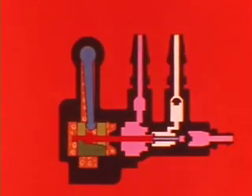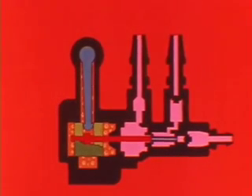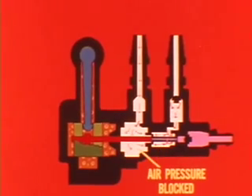This delays opening of the air passages up to one minute before the sensing valve either admits air pressure to the shocks or releases it. Therefore, rapid movement of the sensing valve control arm caused by road surface conditions does not affect air pressure within the shock absorber air chambers. When the shocks raise the fully loaded car to the normal three-passenger height position, the height control piston is forced in the opposite direction by the toggle. As it reaches a neutral or static position, air pressure from the reserve tank is blocked from entering the tubing leading to the shocks by the control valve stem.